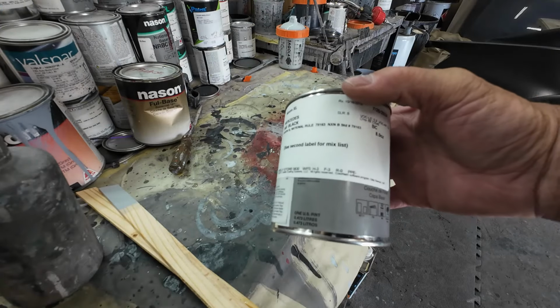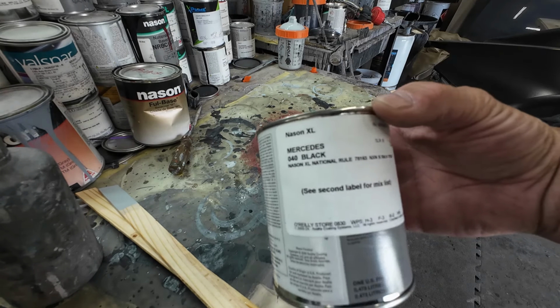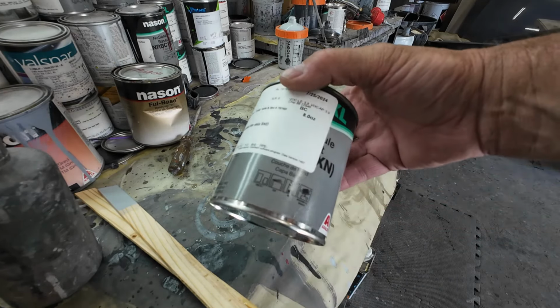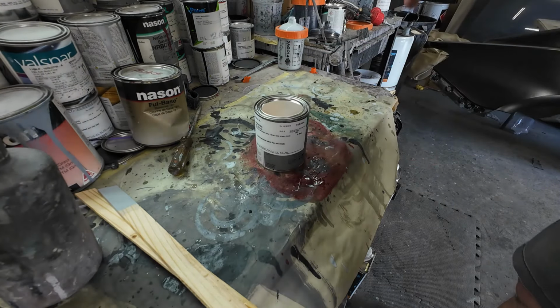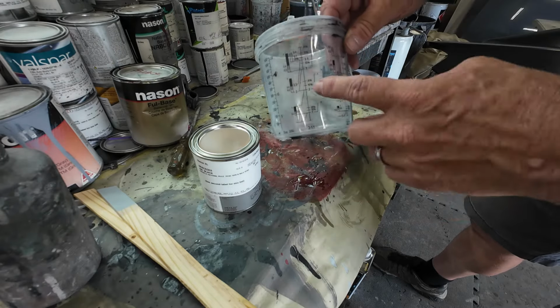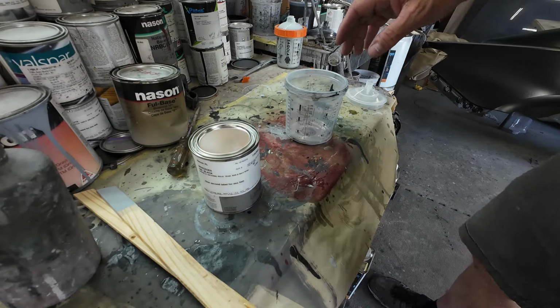Darius is sanding that bumper. We're gonna go ahead and mix up some base coat. This is a Mercedes bumper, so this is Mercedes black here. This is Nason XL. This mixes up 2-to-1, 2 parts paint, 1 part reducer. We're using the Series 1 disposable cup system. This is by Master Pro. I'll leave a link in the description.